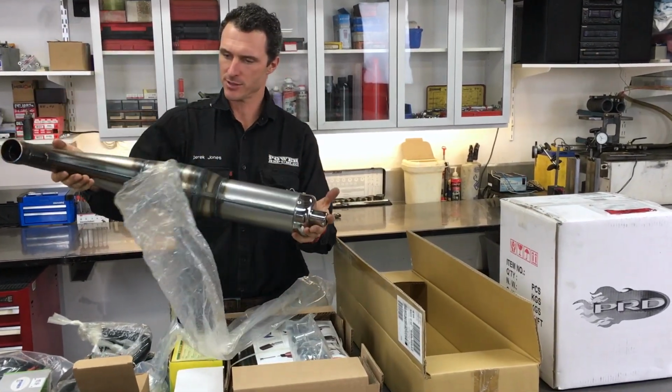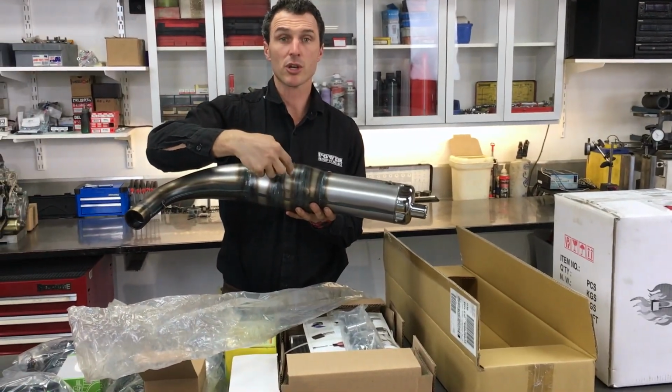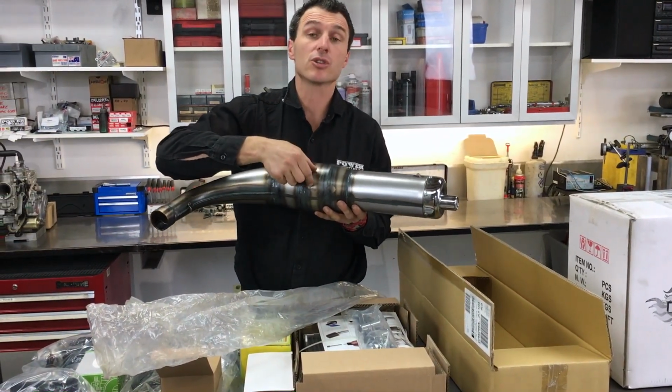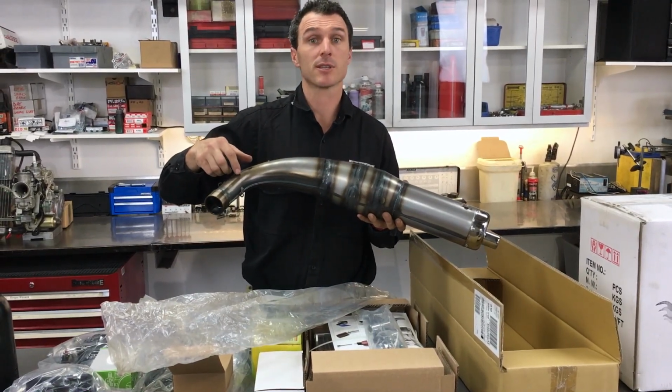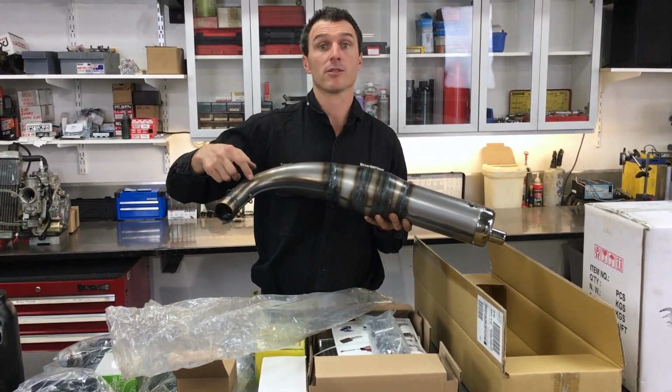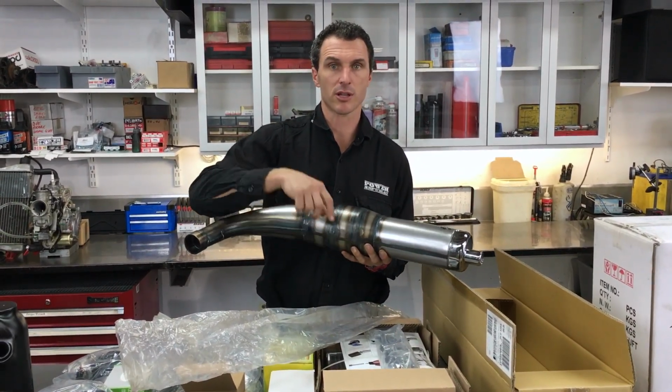Oh yeah, nice. Righto, and you can mount your exhaust socket here for your micro and lambda sensor. And then if you want to use an Easy Tune lambda sensor that's not heated, you're going to put that 110 millimeters from the end. Otherwise, for the micro one, we're going to put it in this straight section of the pipe.